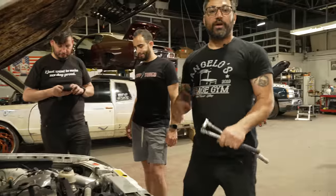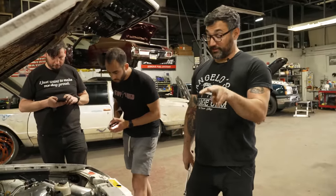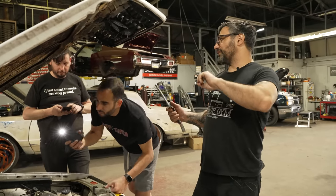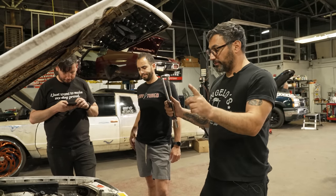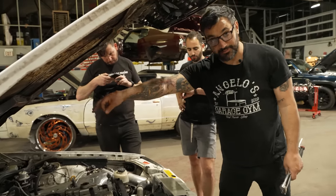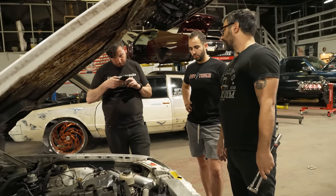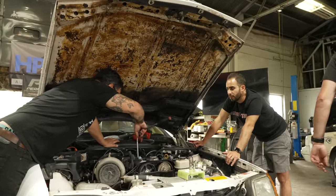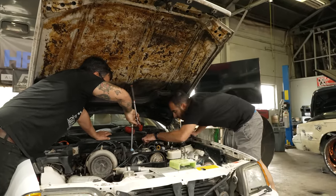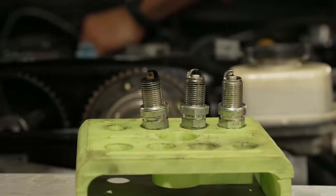This is what they call waste spark. Sometimes manufacturers will have one coil run two cylinders, and they spark at exactly the same time. It does twice the work, because you don't want the ones that fire together, you want the ones that are doing nothing. It's gonna fire for both of them. You find another cylinder in the row that doesn't have anything to do, so if you send a spark through at that point, it doesn't hurt anything. Waste the spark, and then you fire it again when that one's at the top, and waste this one over here. I don't know if we got a ground issue or these injectors are clogged as hell. Hit them with some gum out. This one's actually fire. That's what fire looks like right there.